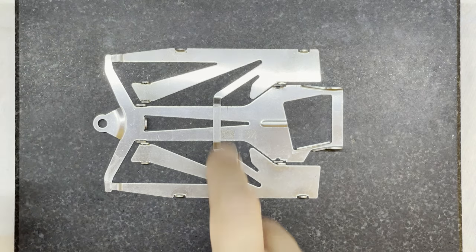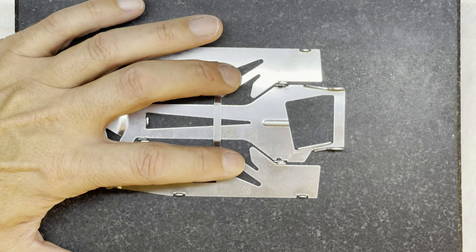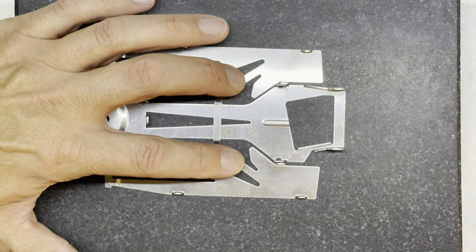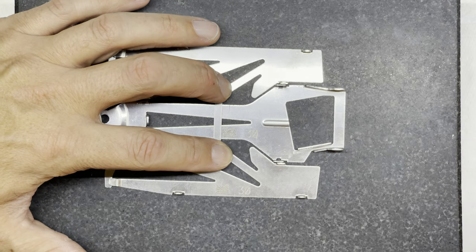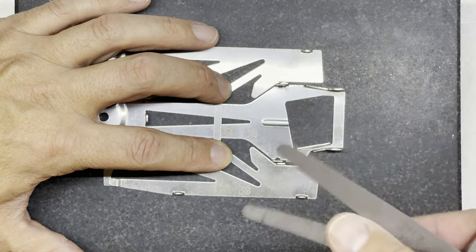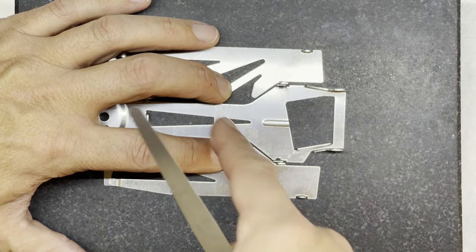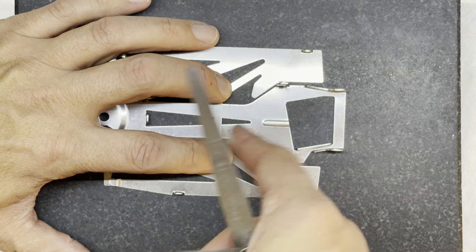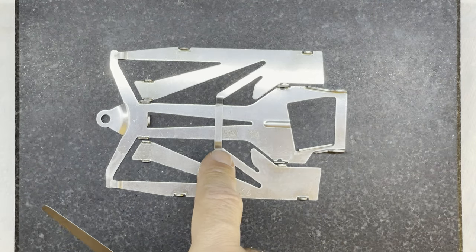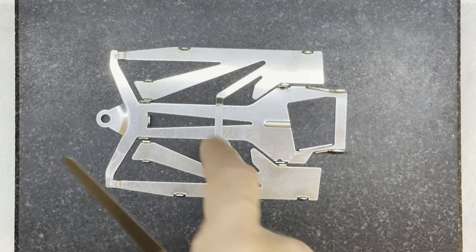What I do to check this bar or to set it in the first place is I hold down these two long bits that come out of the pans, over the top of the center section, and then I take a feeler gauge and run it underneath that part. I run a feeler gauge under there on both parts to see how level it is. You can eye it up from the side as well, but what I want to start with is when these parts are on the block, this bar across sits at the same height on both sides across the center.